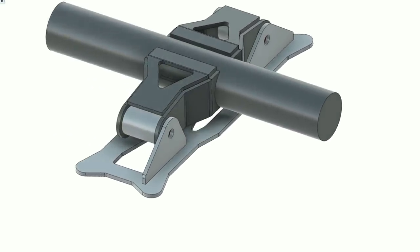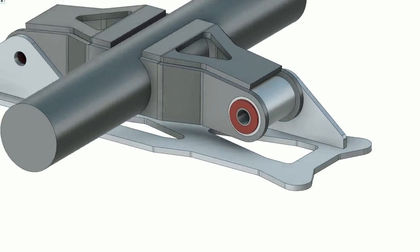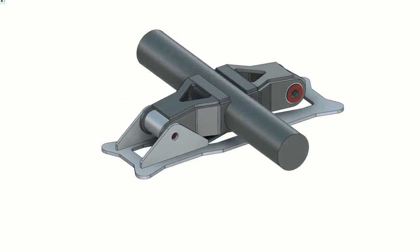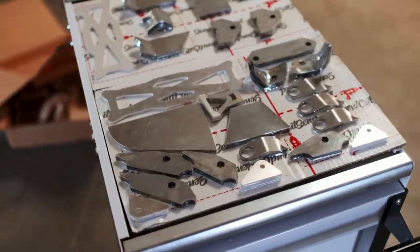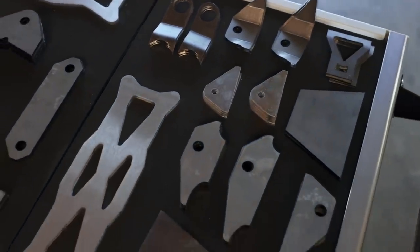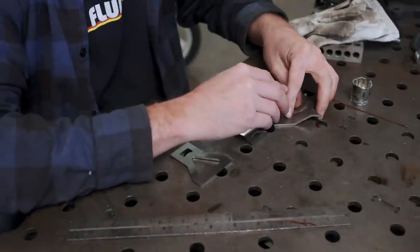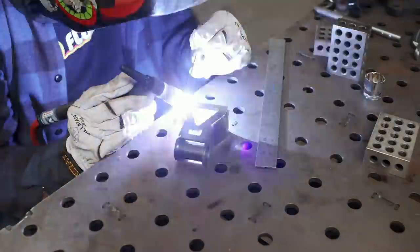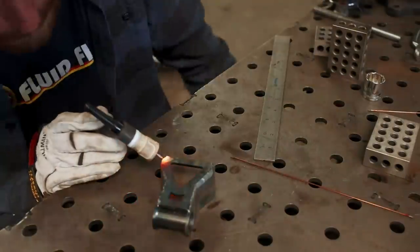It also had no bushings and allowed no movement or give, and thus the aluminum might fatigue over time. So we scrapped this idea and I redesigned it. I focused on getting rid of some of the angles that would make fabrication and assembly a challenge, and instead focused on incorporating a bushing and a sleeve. The purpose is to isolate the intercooler from vibration and give it some degrees of movement, hopefully allowing it to last a lot longer. I sent all of these files out to SendCutSend to have them cut, and they showed up in our most recent order — everything was pre-bent to our specs and ready for assembly.